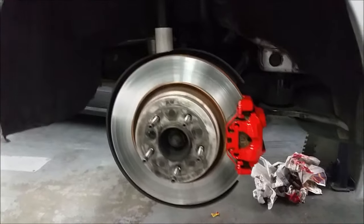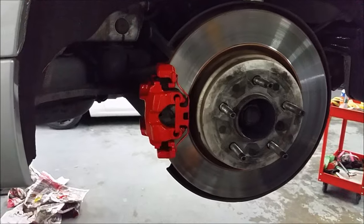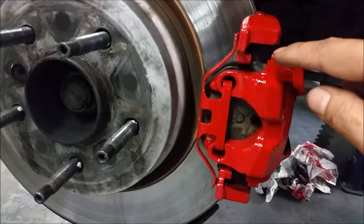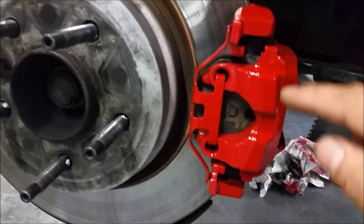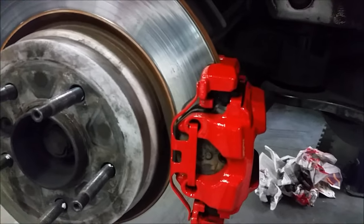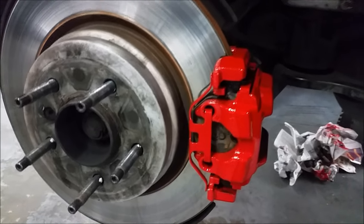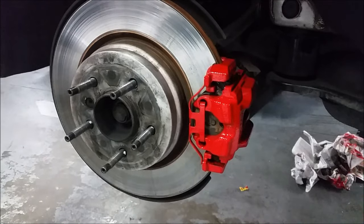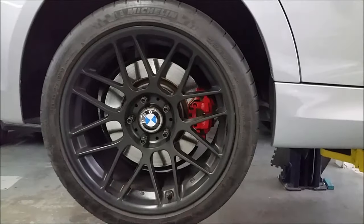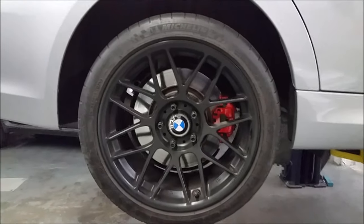They're done — this is pretty much how they look. Here's the other side. Make sure when you reinstall the brake pads you put a little bit of brake pad lubricant so the pad still slides nice and smoothly on the calipers. At the same time, make sure you pump the brakes before you take off and drive your car. Here's what it looks like with the wheels mounted — front brakes and rear brakes. Looks a little bit better, it matches now. Hope you guys enjoyed the video, thanks for watching.